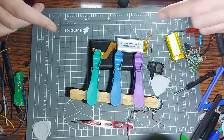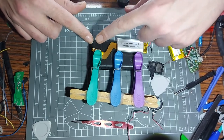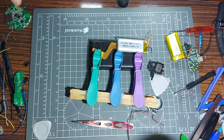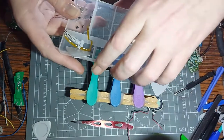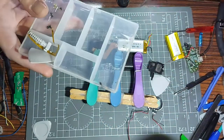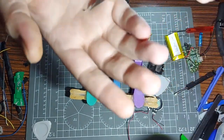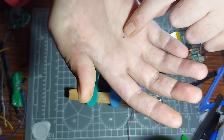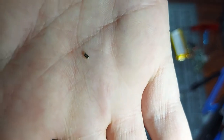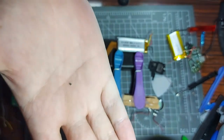I've tinned these two pads here, which is where the backlight for the top screen was connecting via this ribbon cable to the bottom motherboard. Now I dig deep in here - I've got one ready specifically for this, the perfect size. They're all tiny. This is one of my slightly bigger versions - a 330-ohm resistor. I actually scavenged these from old Android boxes and routers. It's goddamn tiny - like a grain of rice sliced in half.